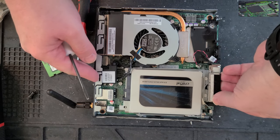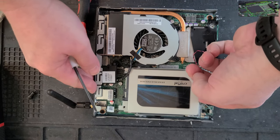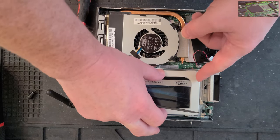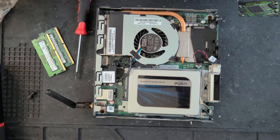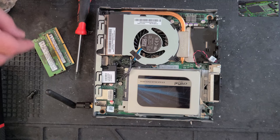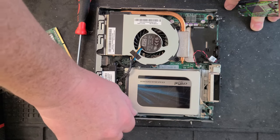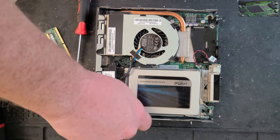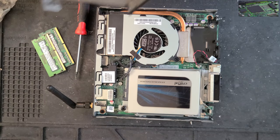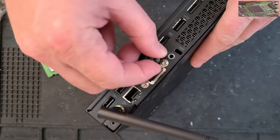This obviously wasn't my favorite solution to leave it largely loose in there, but even when loosely installed, the screws in the drive kept it from bouncing around vertically. I'm not sure if this is how it was intended to be installed, or if they were expecting me to have a right-angle screwdriver. Regardless, with the drive in place, simply screw the hard drive caddy back down with the thumbscrew, close the lid, and tighten the screw on the back of the PC to hold the case cover in place.